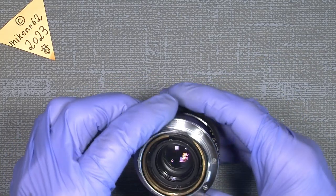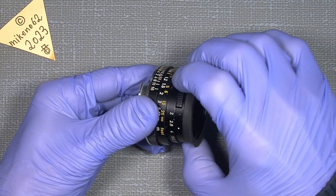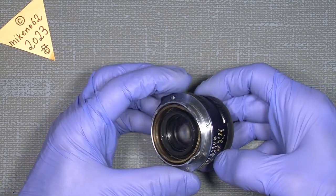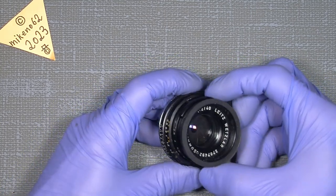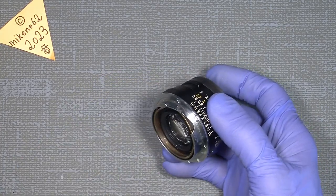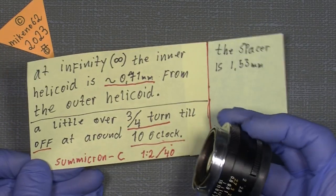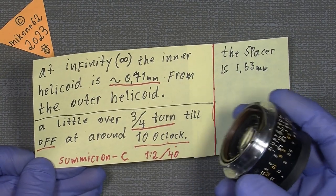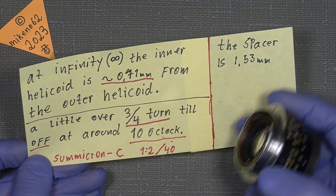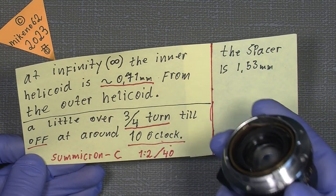As you can see, the aperture ring itself has actually moved the whole lens assembly, which should not be the case. I have been into the lens and actually made some notes about how it actually is, because we have to disassemble the whole focus assembly. It is actually made in a very different way compared to some other lenses, and I took notes on how it should sit when it is correct.